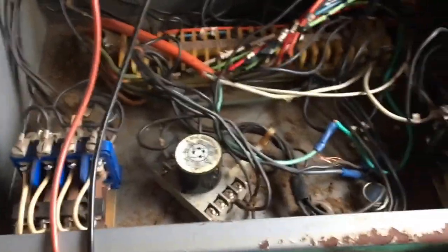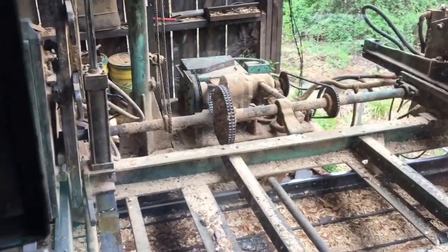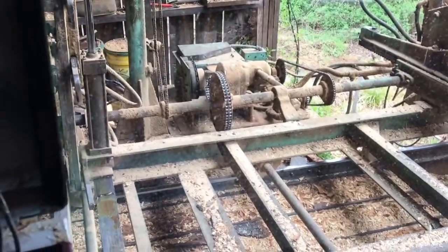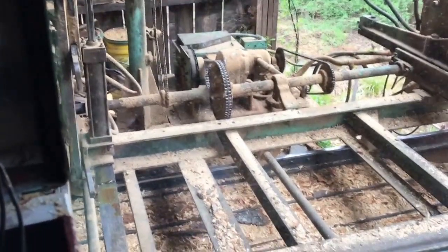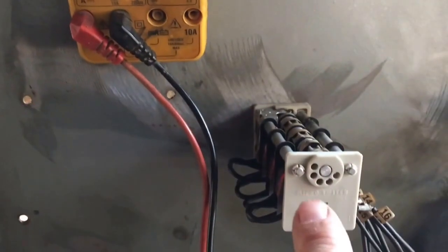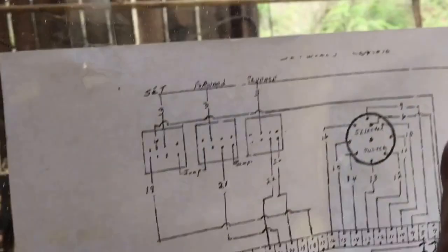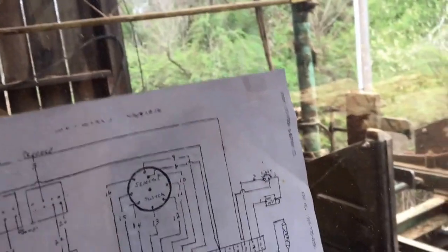But everything seems to be in good shape. And this really is not that complicated. There's a lot of wires there, but that little box you see right yonder — that's got micro switches in it. There's a bar in there that breaks them, and each micro switch represents one setting. The settings are on that thing right there. There's six of them, and that's the selector switching it.